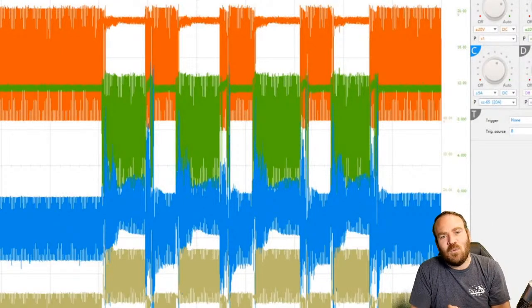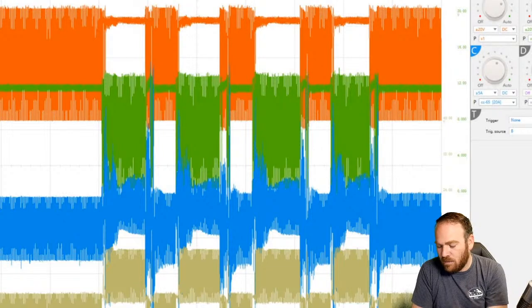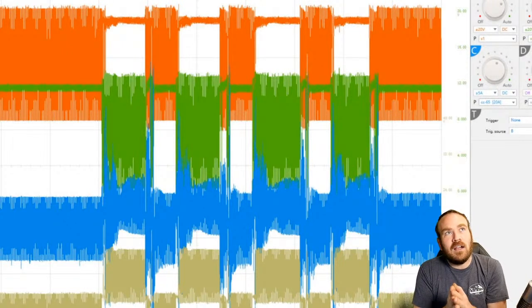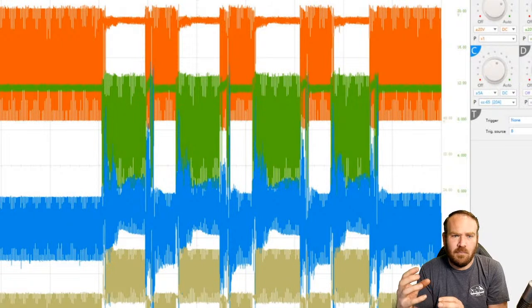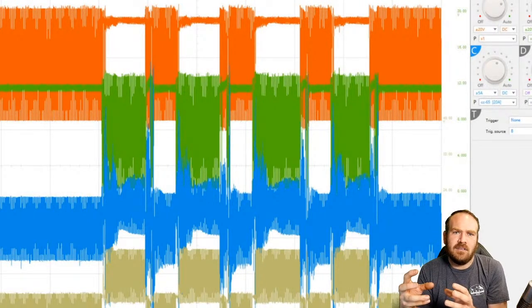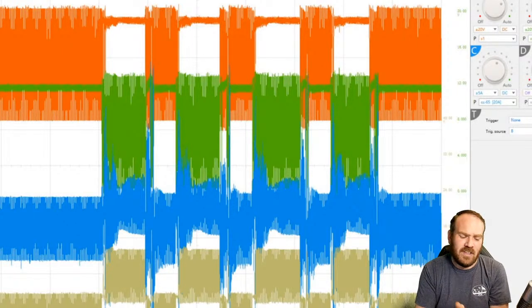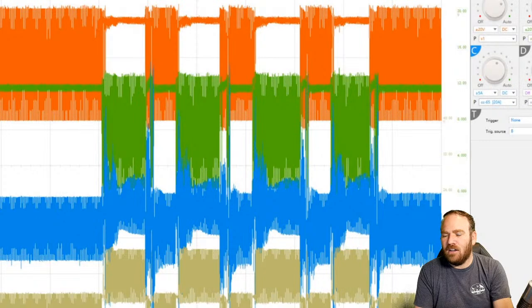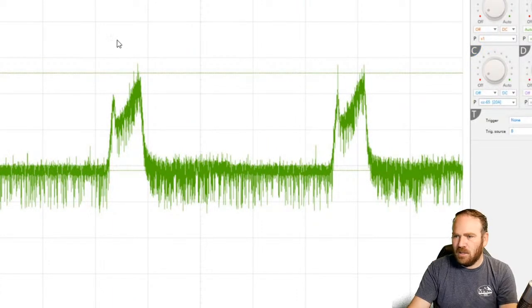Also, I can't remember what the vehicle was. I was thinking it was a Toyota, but I think there's a waveform in here. I don't know if I commented on this one, but there was a throttle body. I remember the wiring diagram showed a throttle body brake, and what it would do is, unless it was in service information, they'd get the throttle body to a certain point and they would lock it. But I'm sure that was on an early system, because most vehicles, they don't want that throttle body held in a certain position at all, in case that brake seizes up and causes it to stick there and you get a runaway situation. But if you guys know of a vehicle that has the electronic brake in the throttle body motor, let me know, because I cannot recall. I thought it was a Toyota system, but apparently it's not.